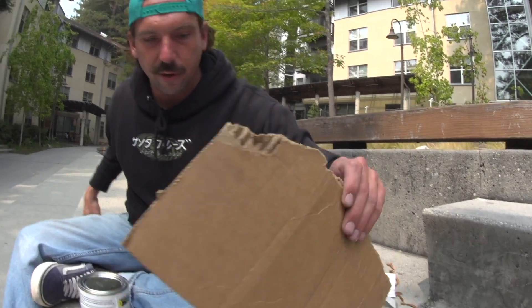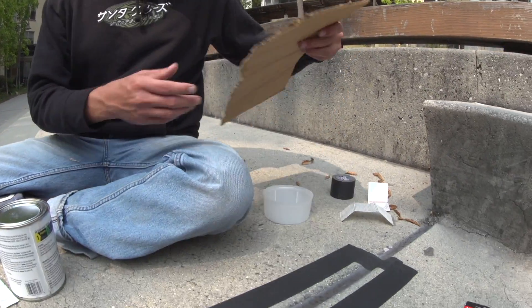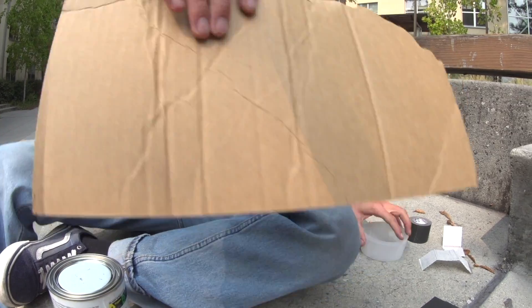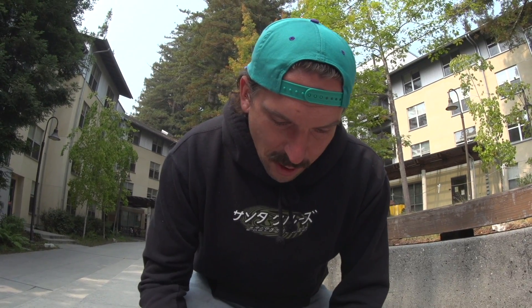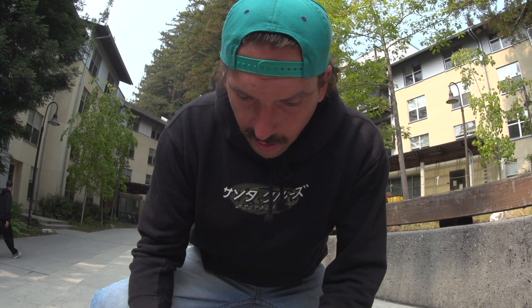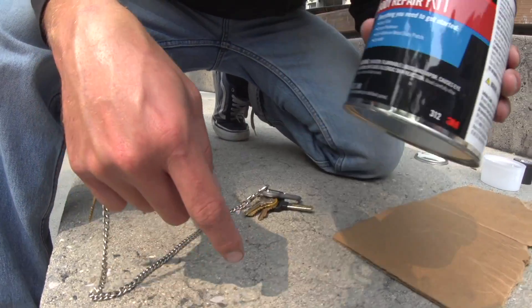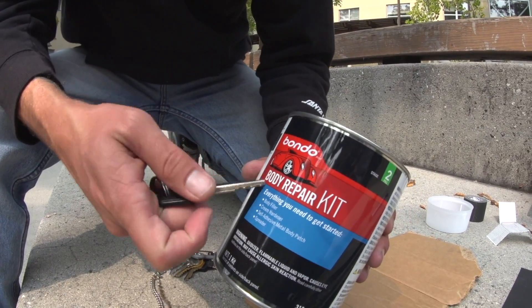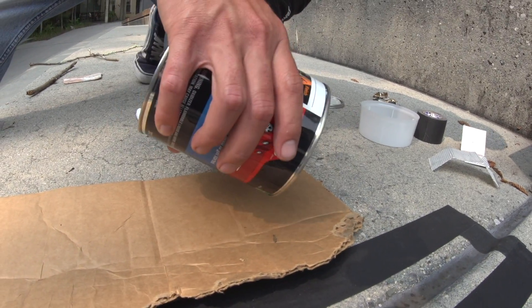So what you want to do is get your whole area set up. You got your spreader — bondo exclusive, ready to go. You got your mixing zone — this is where you're gonna stir it up. Where do you get the bondo? O'Reilly's Auto Parts — hardware stores, wherever dude. You wanna get the one with the red can. Normally we try to get the bigger one, but they were already sold out — I'd suggest getting the bigger one. But you wanna get that body repair. That's the good one right there. Because the crack's so big, we're gonna use a lot.